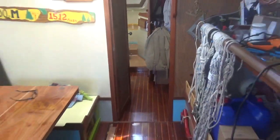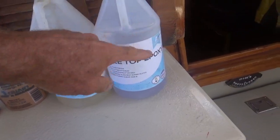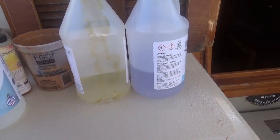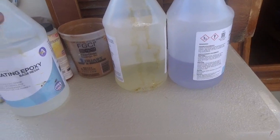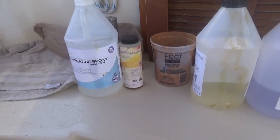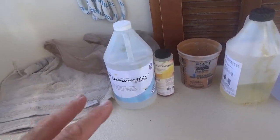Now let's talk about the epoxy — correction, this is a tabletop epoxy top. It's the exact same stuff I used in the head and on the deck. It doesn't have to be brown — it comes in any color you like; the shop sells tons of different colors for mixing. It has a part A and a part B, and you'll notice they're at the exact same level in the jugs — that's because you mix it one to one. Contrast that with laminating epoxy, which is a three-to-one blend — that's what you mix with fiberglass cloth for structural work. They each have their own purpose.